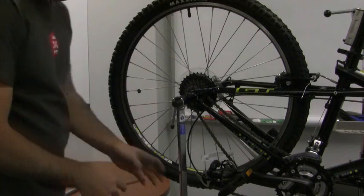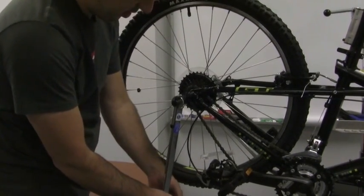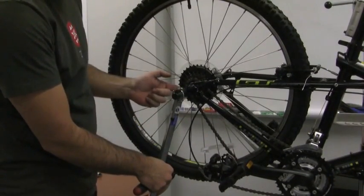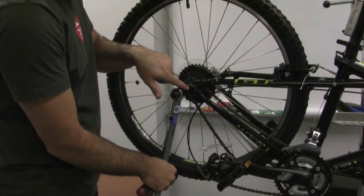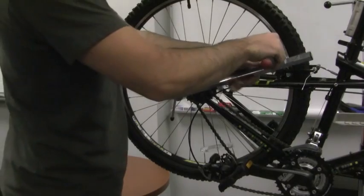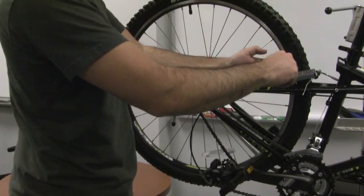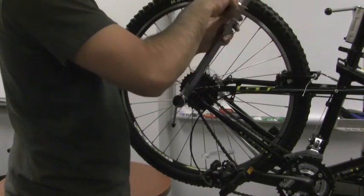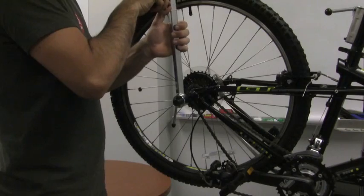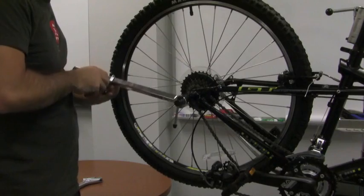Normally there's a pin here, but you can also just use your 5mm Allen and loosen this piece here. This can slide up and down because the derailleur hanger bolt is not at the very center of the wheel — your axle is. So start over here by the brake, push your tool in, and look at the distance between the end of the tool and the rim. As you go around, check every eighth part of the circumference of the wheel or so.